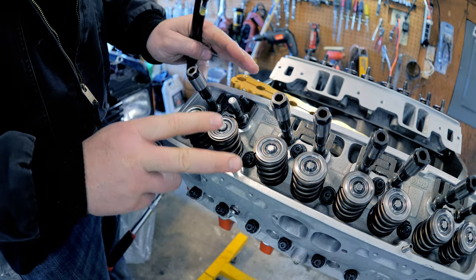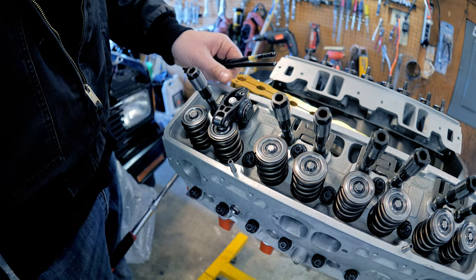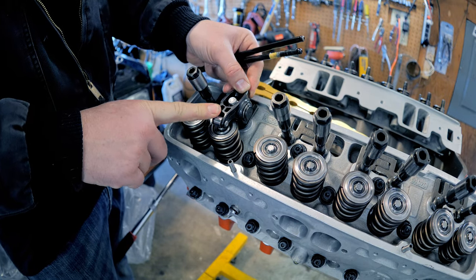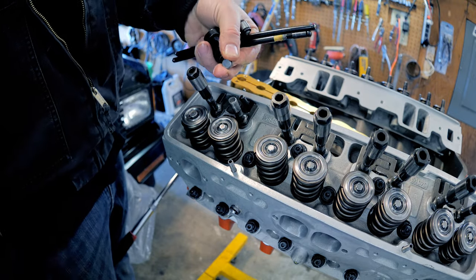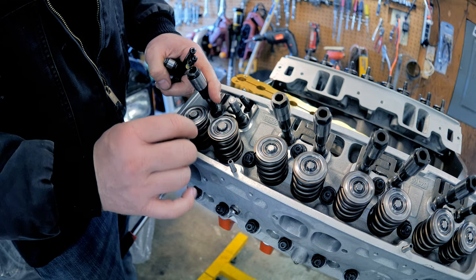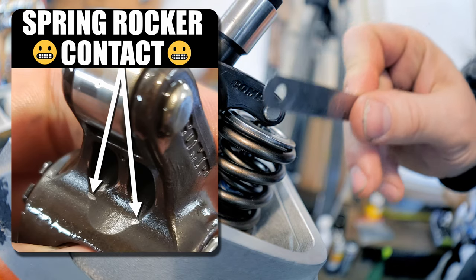Before you can do anything on your geometry, make sure whatever rocker you use, you use the exact same rocker when that motor is running. Whenever you get your geometry, make sure you use the exact same rocker — you can't use one and get another one and expect them to be the same, because all these guys are different. They're all slightly different and they're all going to have different clearance issues.